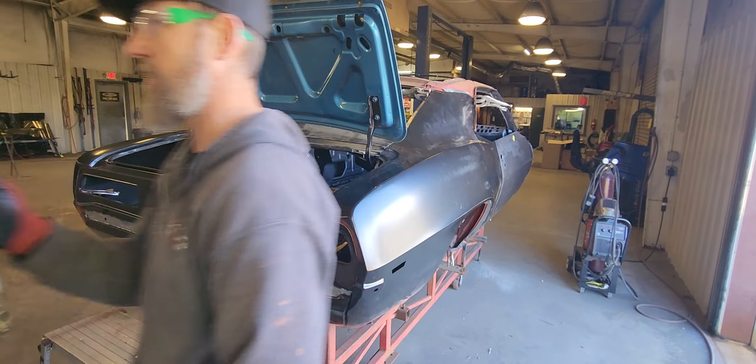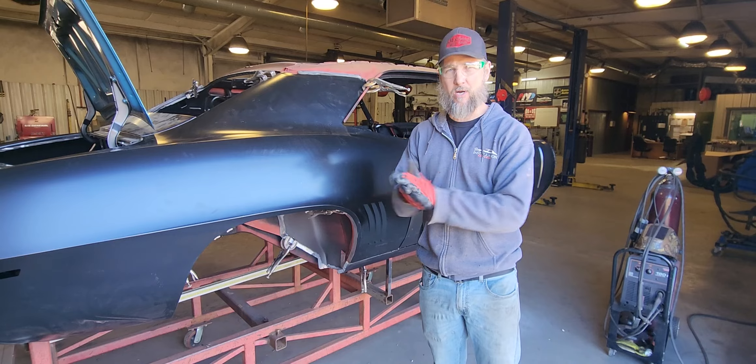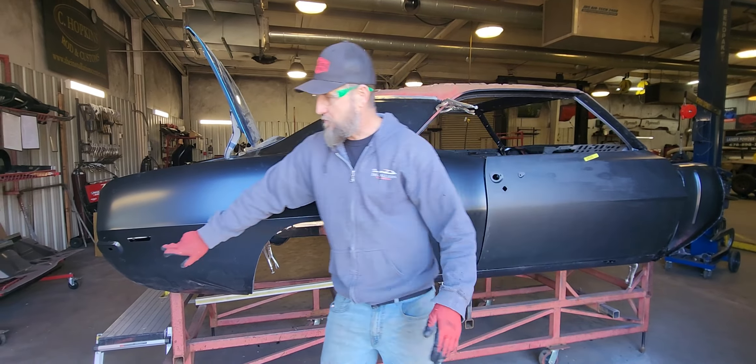He's talking about in his video putting the monkey on a stick. This is an SSRS so it had a spoiler, so the springs are heavy — it won't stay down on its own. For anybody that don't know, this is the monkey on the stick, and it's your best friend when you're building these cars. But if you stick the monkey on the stick in here right now, and you've got this loose, and you're trying to lift the quarter to close that gap, you're going to start pulling up on this area and leave this behind. That's going to make this roll over and make this gap get tighter. You don't want to move this gap because this gap is perfect. So you don't want to make your up and down adjustment right here, because if you roll this up, it's going to close this gap more and then you're going to be fighting that issue. All this is profiling good, this is in the area, so you don't want to use the monkey on a stick.